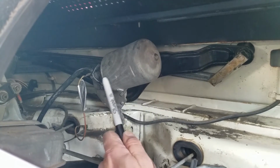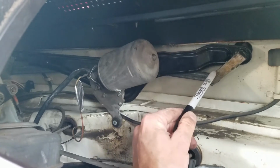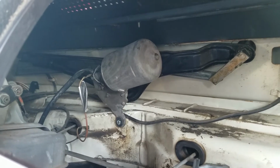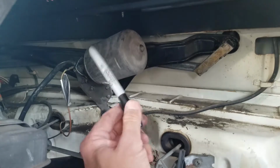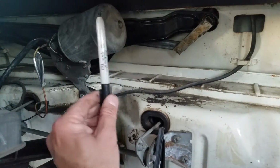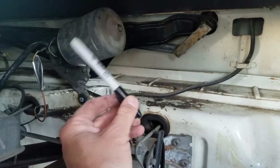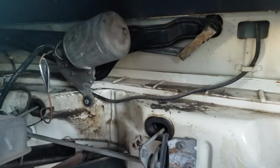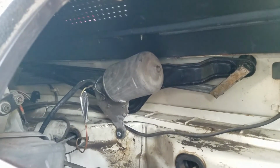And I had the guy at the Volkswagen shop swap it out, because you have to compare how the gears sit with the arm, the default arm position. Otherwise, your windshield wipers won't wipe. Let's say the resting spot is to the side, right? It won't wipe this way. They might wipe this way, or this way, and it doesn't do you any good if your windshield is oriented this way. You want the blade to go across the windshield, not two-thirds of the windshield and one-third of the front of the vehicle, or worse, the bottom of the whole entire front of the vehicle. Anyway, don't put the windshield wipers or blades on yet. Once you're done, you gotta make sure it sits right. So tilt them out.